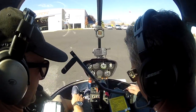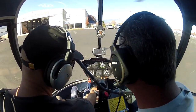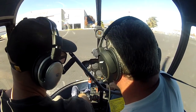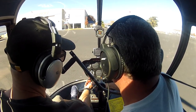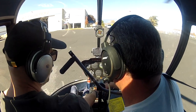So you've got it in the green, so I like to have people test the right mag first. So I'm going to go two clicks down, and count 1,000, 2,000. You want to make sure it's less than 7%, but as soon as you get that two seconds, click it back. Let me just demo it to you one time here.